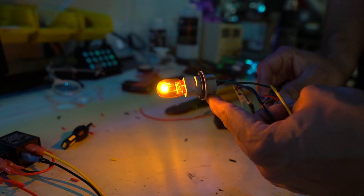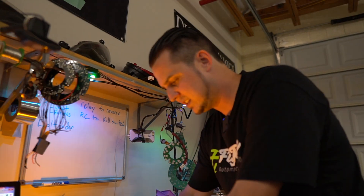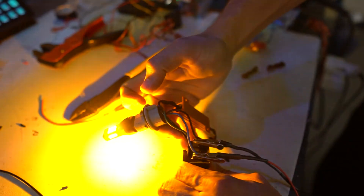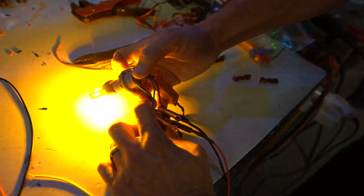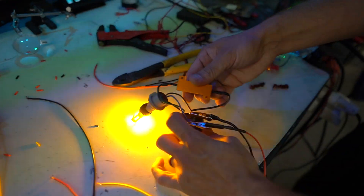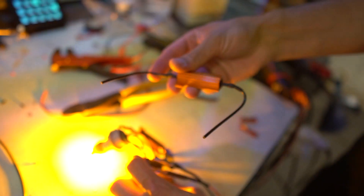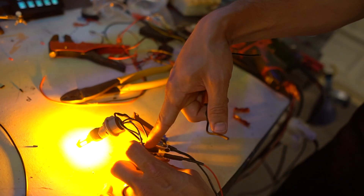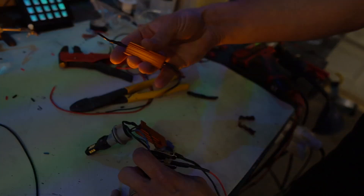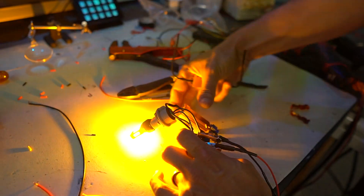So this time we're going to try with the LED and a load resistor. We've just hooked up a load resistor. The old setup I had was pretty bulky and stupid, but the ones that come with these flyride bulbs are just the standard little gold-looking 50-watt, 6-ohm resistor. There's not really anything special to it — it just hooks up at power and ground. It doesn't matter which side goes to which; one side goes to ground and the other is hooked up with the turn signal power wire. So it's acting kind of like a light bulb — it gets power and ground at each end, but it gets warm instead of turning into light. That thing's flashing; this thing's getting a little juice of heat.